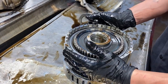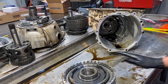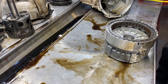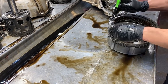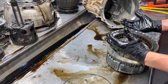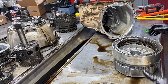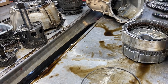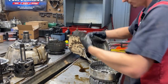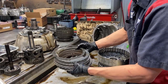We had a bearing fall out - sets down in there, set that to the side. We're going to flip it over and get our two-six clutch out first. On resetting this back up, they don't have a clearance preference but they want it to hold - I think it's about 30 to 40 PSI - and they want a good hold on that clutch, a good seat, to make sure it's working correctly.